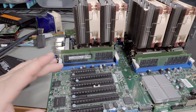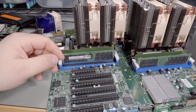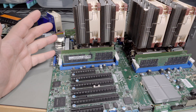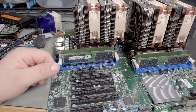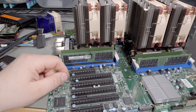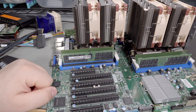Currently I have three servers. I have a Plex server, a TrueNAS server, and a little VM server. Right now I'm actually running an X299 7980XE Intel system. I had a Ryzen system in it but there was a weird bug specifically with the X570 chipset — the system was restarting randomly. By the time I replaced it with the X299, someone had figured out a grub fix, but it was too late. I already swapped it and just kept running the X299.